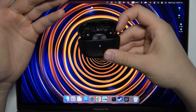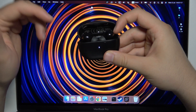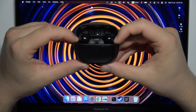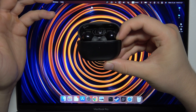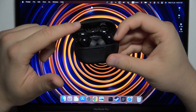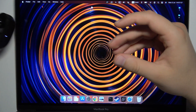So right now, just open the charging case and input the left and right earbud inside. As you can see at the start, this indicator is blinking white, but we have to wait until this indicator starts blinking quickly — it will take around five seconds. We have to keep that case open, keep the earbuds inside, and put it close to our MacBook.